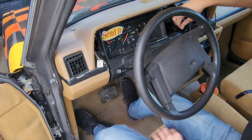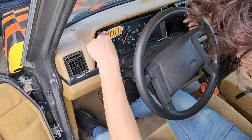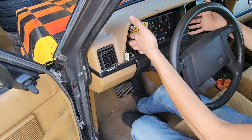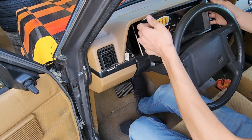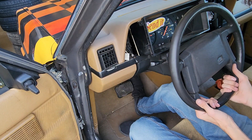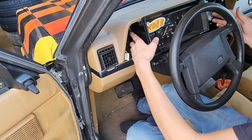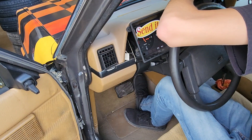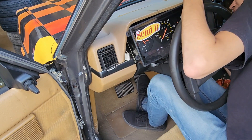Just simple push-in pins. Mine are worn down so they come out a little bit easier, but yours won't be too hard to come out either. You'll see four Phillips screws, two on either side. Once you have all four screws out, go ahead and grab onto the sides here and give it a pretty firm pull. It will be a lot easier if you take out the steering wheel — fair warning, it'll be loads easier. I'm pretty stubborn myself, so I'm going to go ahead and get behind the dash and pull out all the plugs that are in place.